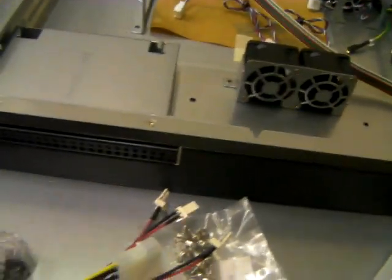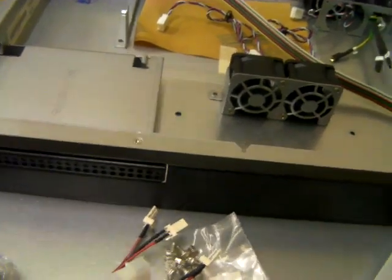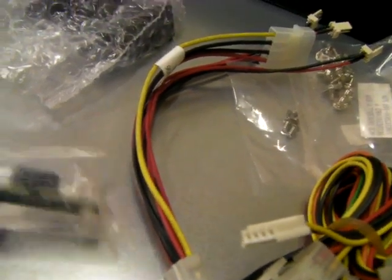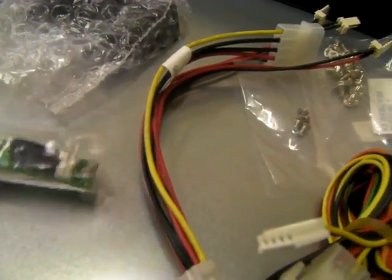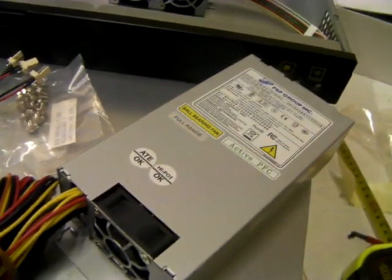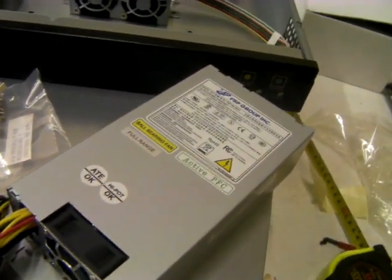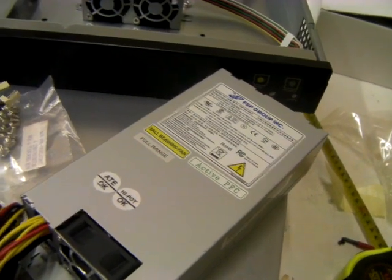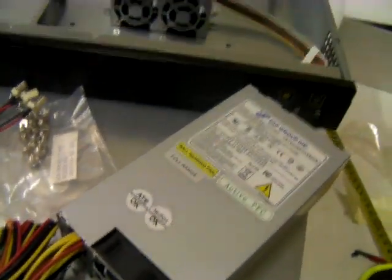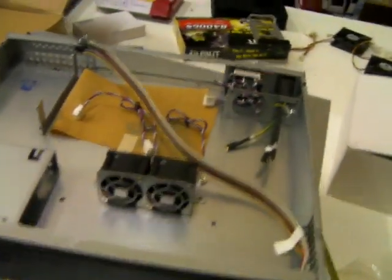You'll note on the front of the case there's a space for a Slim CD ROM. It does come with this little adapter for a SATA DVD rewriter, Slimline one, which basically just allows the floppy drive connection to power up the SATA drive. So realistically, if you've got one SATA hard drive, and that's all it will take anyway, you're going to need a converter from a Molex to a SATA. We've got thousands spare if you need any, and you're buying the case from us, just ask.